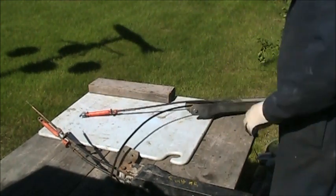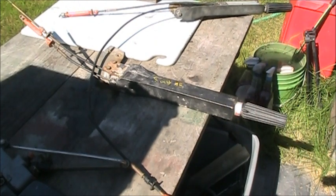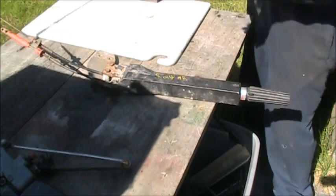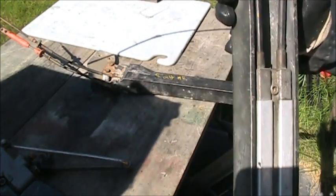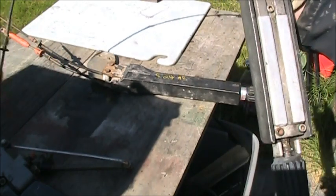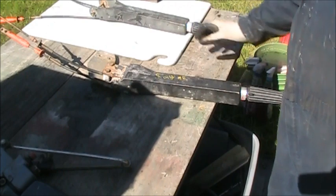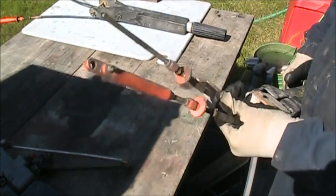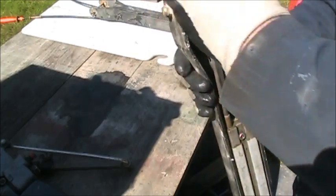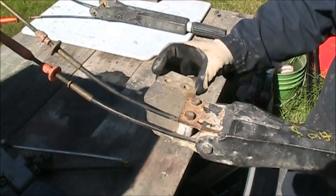I don't know if you can see that even. Watch this guy. Watch that cable. See? So they've got the cables run basically, it looks like, in some kind of rack in here. There'll probably be some kind of pinion gear hooked to the throttle itself. But this one just bolts on that way with a bolt up and down, so I'd probably have to build a bracket. This is essentially the same one, but it has shorter cables. This cable's all roached, but they built that kind of bracket, and that would bolt right onto that Mercury right there where those two holes are, because it has a spot on the Merc for that.